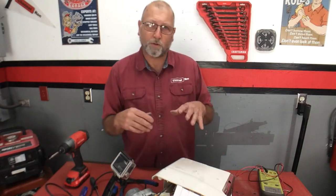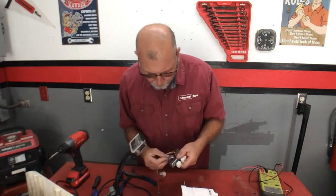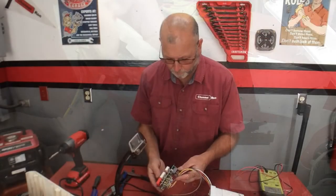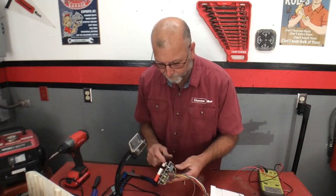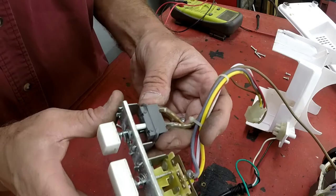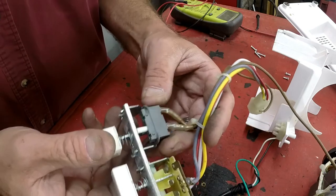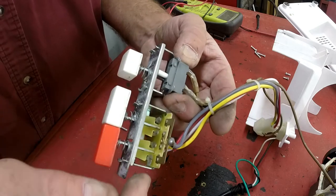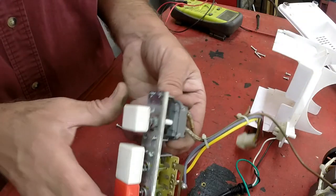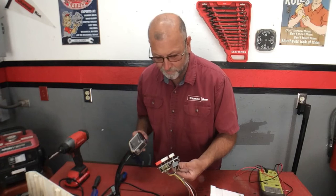I'll go take a look at that and come back to it. Okay, so I found the problem. As I said, the circuit breaker fell out, and the reason it fell out is this is just really a piece of junk. It's definitely an older model. Look at the contacts — I may actually try to file those down a little bit, just clean them up with a piece of sandpaper. It worked when we bench tested, but rather than put it all back together and then have a problem, I may just clean those up. As you can see, this is just squeezed in there by these two pieces of metal. So all I'm going to do is try to duplicate what they've done — just squeeze these little tabs down to help hold it there — and then give it back to the client and hope for the best.